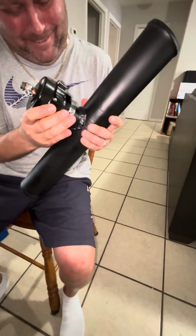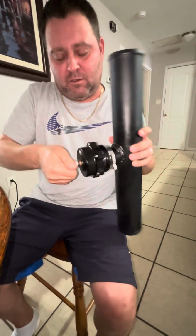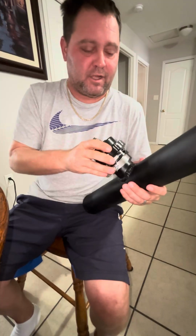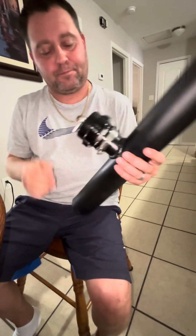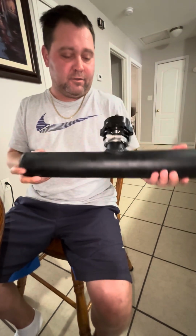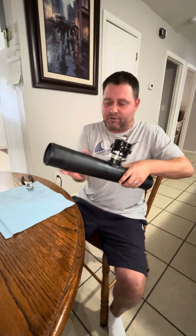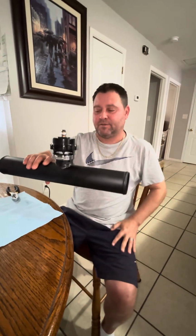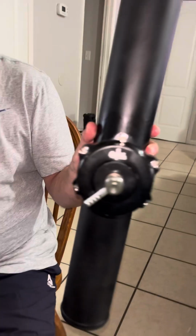And then this piece should not move at all. It is on there. And then, like I said, leave this piece so it can swivel around, so you can put the boost line reference from here and figure out how you want to place it. So I just snug it up like that. And there you go. That's the charge pipe that goes to the intake and the throttle body. So actually, this is one of the pipes that goes to the throttle body. And there you go. Not that hard.